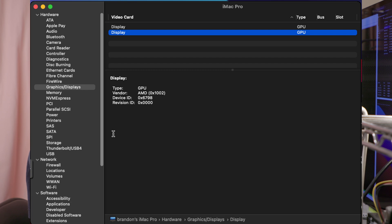Windows seems to be a non-option, so maybe a macOS VM with GPU passthrough would work — it's the OS it's designed to run on. I tried installing a macOS VM in a version compatible with this hardware, and it installed fine. It shows the GPU in system information, but just shows it as an AMD GPU with no detail. It doesn't output anything to a screen connected via HDMI to the GPU, and doesn't seem to use any hardware acceleration. It seems to detect the GPU but not be able to use it, and I don't know enough about macOS graphics to get anything more out of it.